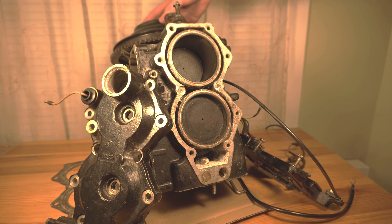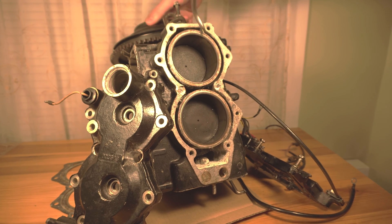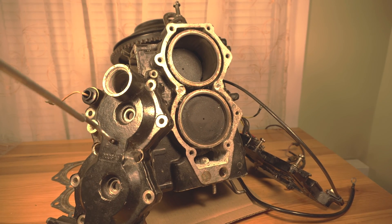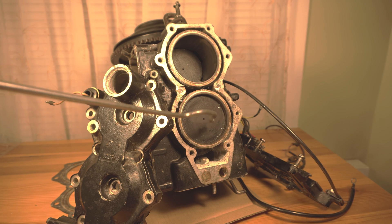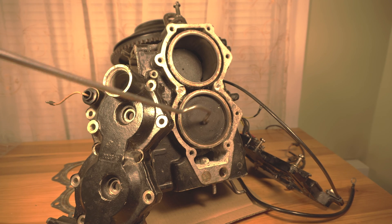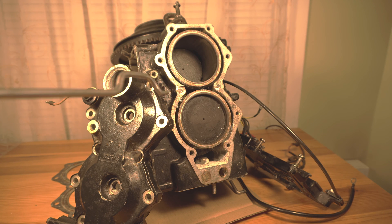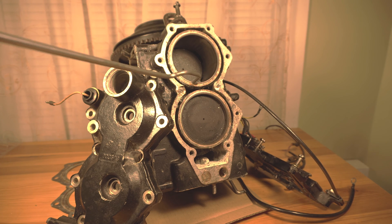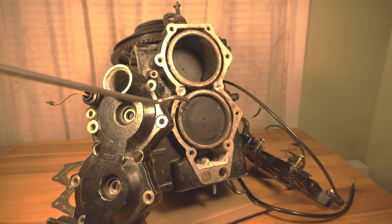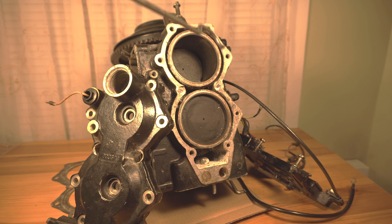Now this is just a test motor and as you can see the pistons run. This plate here is the front plate, the spark plugs screw in here, and obviously as the pistons run this is where the ignition or explosion happens. Normally when you start up the motor, water flows in here — it may be difficult to see in the video but around every piston there is a hollow area, and this entire hollow area on the sides and everywhere is filled with flowing water.